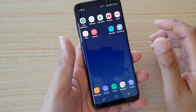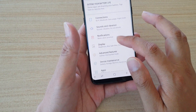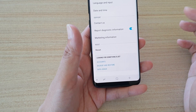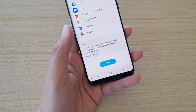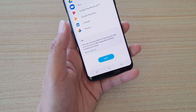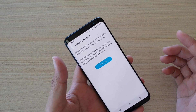The last software solution is to reset the device. If you've tried everything else and it doesn't work, go into the settings screen by swiping down and tapping the settings icon. Go to General Management, then tap on Reset, then tap on Factory Data Reset. Before you reset, make sure to back up all your data because once you reset your phone, all data — contacts, photos, notes, and anything on your phone — will be totally erased. So be very careful, and back up your phone first before proceeding with the reset.